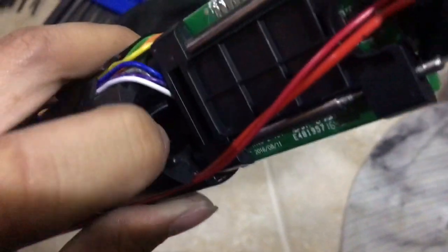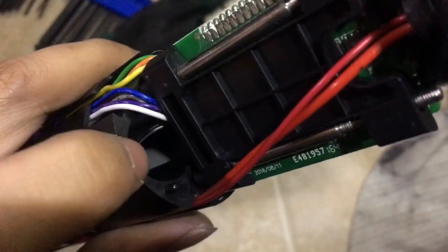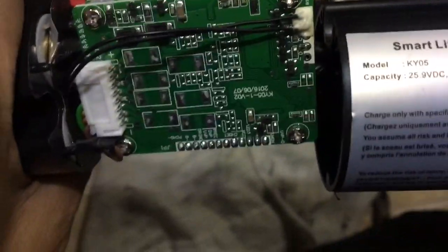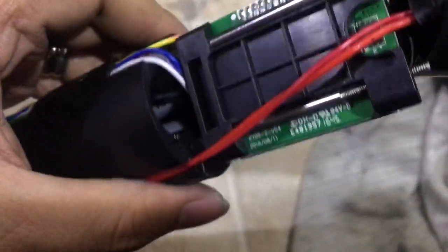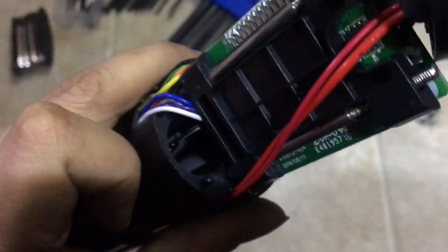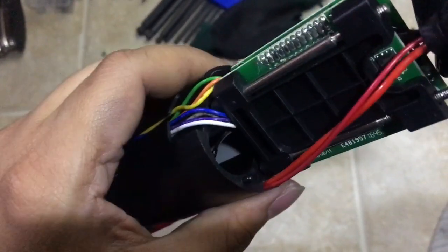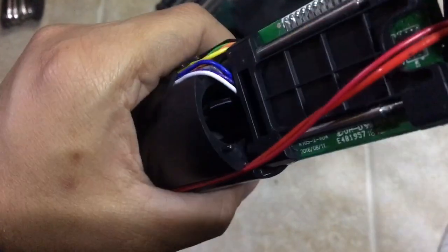It looks like there's a space here for seven more lithium-ion cells. At the moment, this is 3.8 amp-hour, and the run time on this with my weight is 12 kilometers. If we add more cells in this, run time is longer. But I'll have to check the current capacity of the cells to hopefully match it up with whatever is available online.